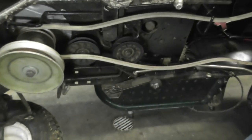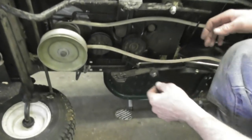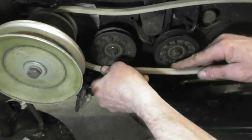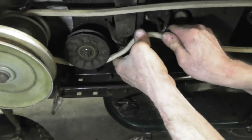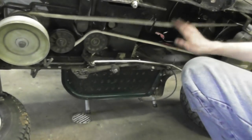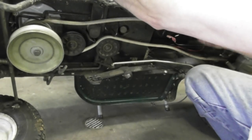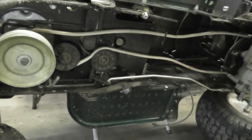To get it on here, we've got to set the parking brake. Push down the pedal, put your parking brake on. Then you come down here — it's a V pulley, there's a little guide there. You're going to want to get it around that. Now bring it up and just push it on there. Now when you release the parking brake, it makes the belt tight. When you push it in, it gives it some slack so it won't spin on you.